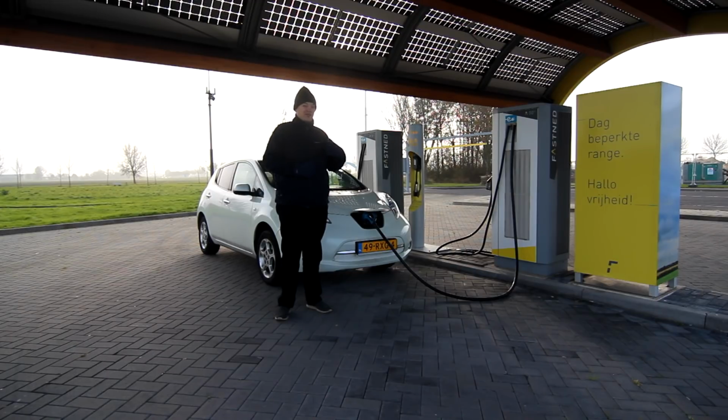If we would ask for even longer springs and make this car sit exactly the same as it sat originally in the rear, then these springs will not be available to people with a smaller battery pack or less load on the rear axle. So yeah, it's a bit up in the air, and I would love to hear your comments on this.